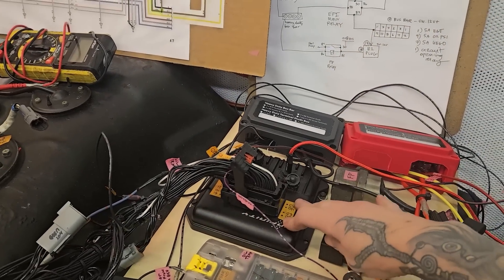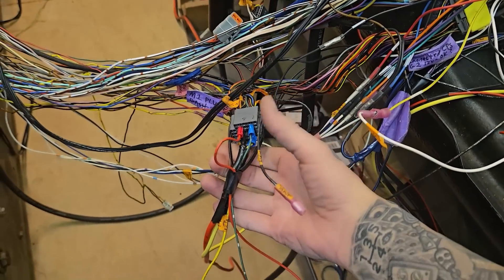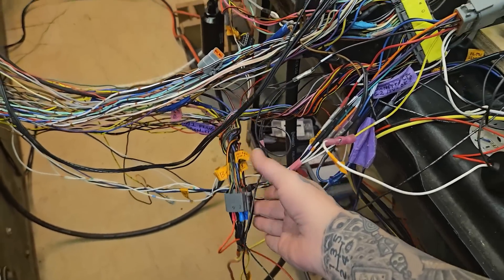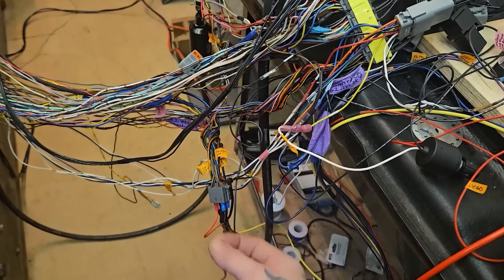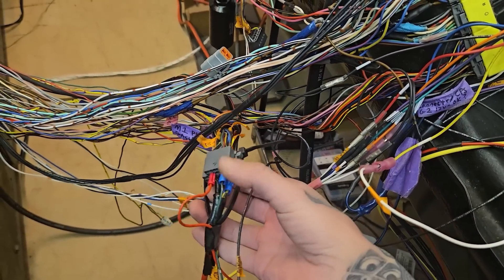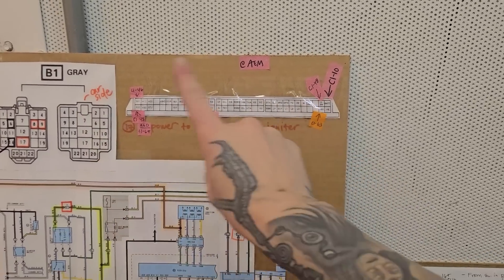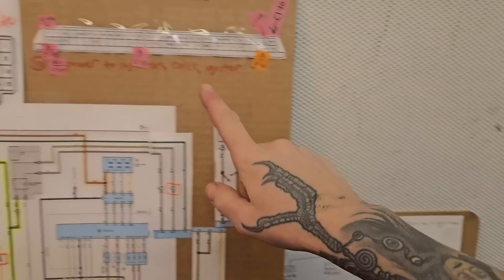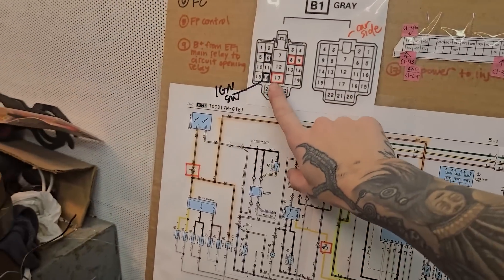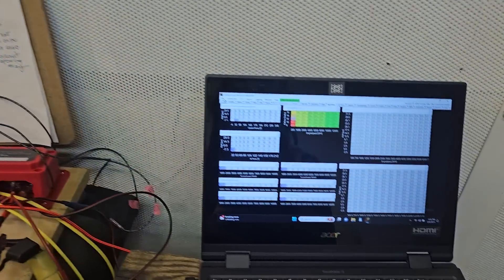Setting this up was kind of a pain because I'm not really great with computers or electrical stuff — I'm still learning all this stuff. Basically, I'm getting all of my power and ignition switch signals from my B1 plug. One of the reasons this was a little difficult to figure out is that the 89 is like in a weird split year, so a lot of the diagrams — you really have to make sure you get a diagram for an 89. You can't just go on forums and ask what plug goes where. I receive fuel pump control signals, my ignition signal, and my EFI main power through the B1 plug, also through my C1 plug. Here in pink are all the pins I use to power up the Infinity: the C110 plug which is constant battery power, grounds, and ignition switch, which is the really important one that turns everything on. I'll power everybody off and get the battery back on the trickle charger before I leave for the day.